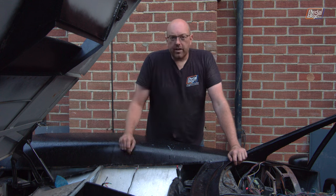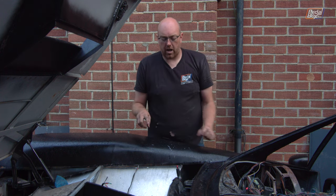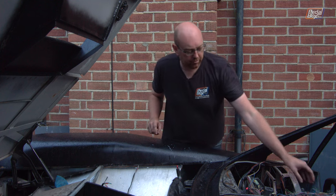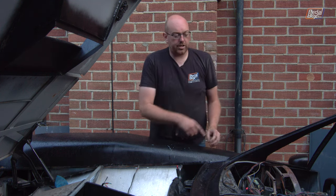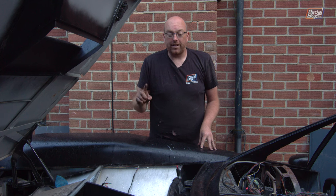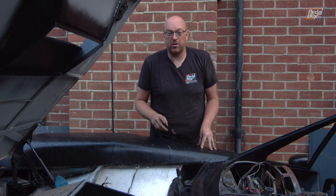Now, the brake fluid sensor that we need to put in here, we're going to put on the front circuit, because they are two completely separate circuits with two completely separate reservoirs. That just runs directly into the cluster on the back, and it's a wire that we've actually terminated previously. So we just need to join a new wire on there and run it straight round. But we're not going to do that right now, because it is getting heavier. So I'm going to start throwing as much of this stuff back in the garage as quickly as possible after the camera.